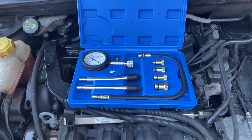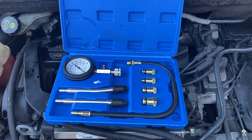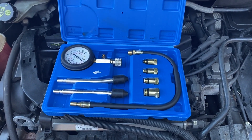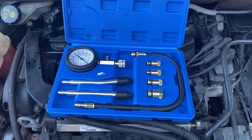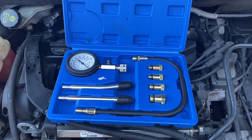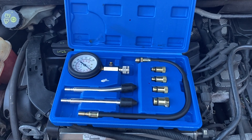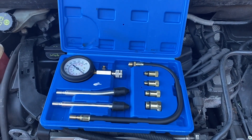The first test we're going to do is a compression test. It essentially measures the amount of pressure generated by the piston as the engine cranks. If we've got low compression it means there's a leak — either down into the crankcase past the piston rings, up through the intake or exhaust valves, or it could even be leaking across into other cylinders or into coolant jackets in the engine if the head gasket is damaged. Let's get the compression tester hooked up and see what compression we've got on each cylinder.